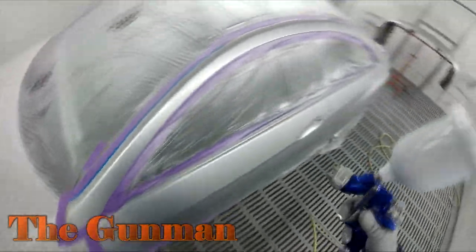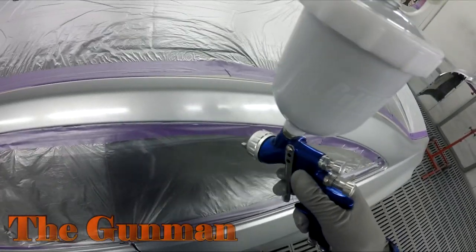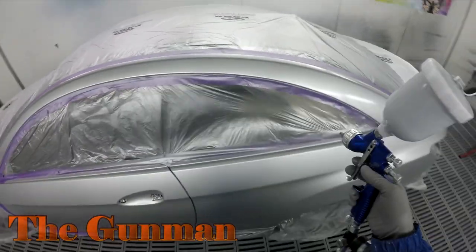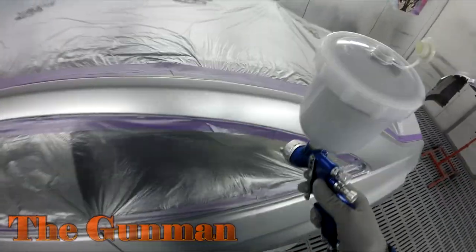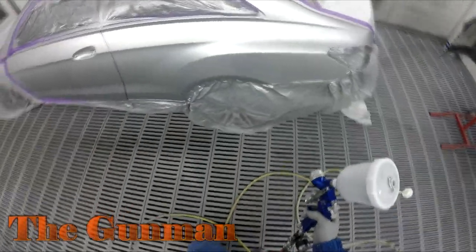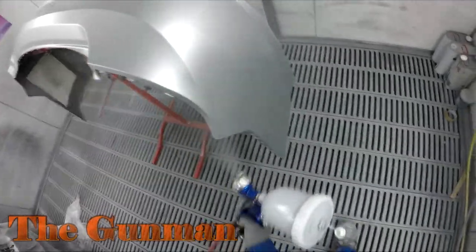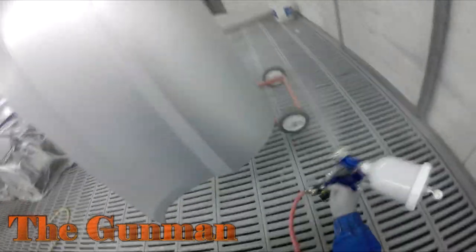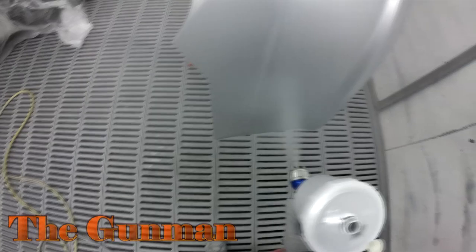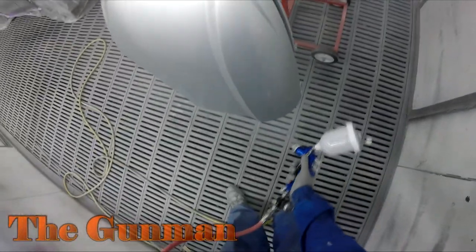The only real letdown of solvent is fry-ups and shrink back. The waterborne is a better quality paint, but being able to put coats on rapidly, walk out of the spray booth, clean your base coat gun, mix your clear coat up, and come straight back in to clear it — you don't have that downtime of standing there with blowers moving them around the panel. Even if it takes the exact same amount of time from applying base coat to being ready for clear, it just feels like you're working, not wasting time.